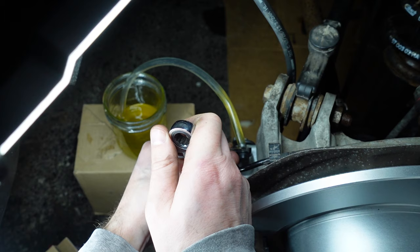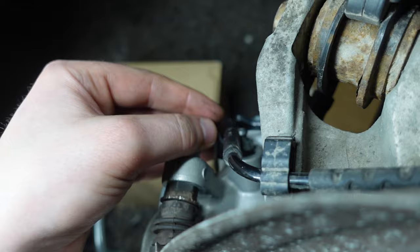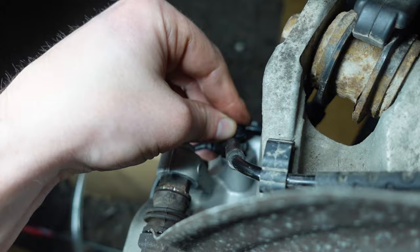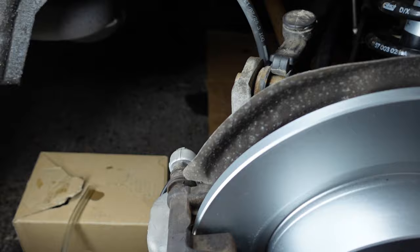To bleed the brakes you're going to need two people: one to pump the brakes, and one to open the bleeder valve and let the air bubbles out until it's all set. It's a good idea to put more fluid in the reservoir beforehand so you don't run out. On an R60, the brake fluid reservoir is up in a hidden compartment in the sill — pop it open and there's your reservoir. After bleeding, move the hose, tuck the sensor cable inside the cap for the bleed valve, and pop that cap on so no dirt gets in. Put the tires on, double-check the reservoir, and go for a test drive.